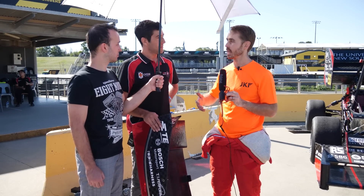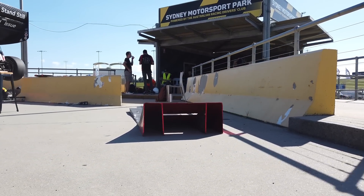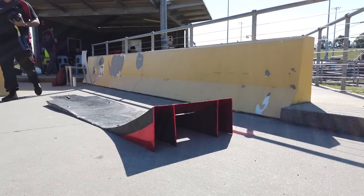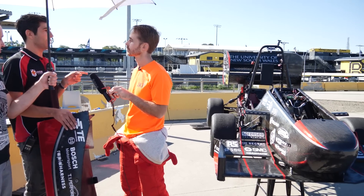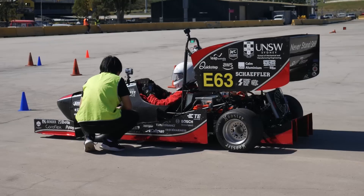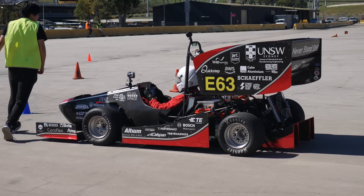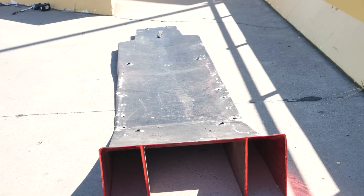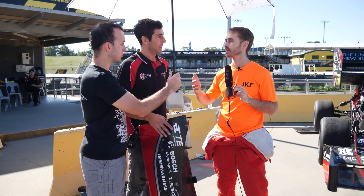Let's talk about the rear diffuser. A lot of changes were made on this car — that was one of the big suspension compromises. On the previous car in 2022, the lower posterior control arm was a lot further rearwards — it went almost back to the jacking bar — which obviously limited the amount of diffuser space available. One of the design discussions we had with suspension was: can we move that rear lower control arm forwards to open up more space for the diffuser? They were able to do it in terms of their kinematics, and so that allowed us to leverage a lot more expansion out the rear of the floor.